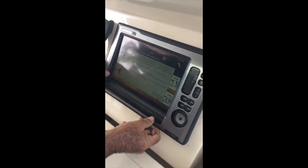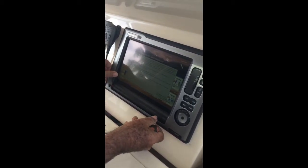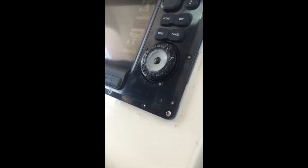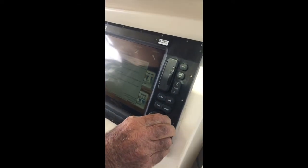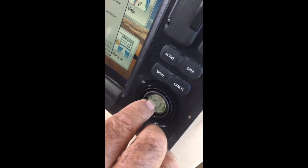Work your way down the side to the next corner and carefully pry that up. Continue around the display unit until the bezel pops off. Remove the two small screws holding the dial in place and pull the old dial out. If you are also replacing the clear button actuators below the dial, pull the old ones out with tweezers or needle nose pliers. Assemble the new actuators as shown in the instructions, and simply pop them into the new hole with the keys on the side aligned with the slots inside.